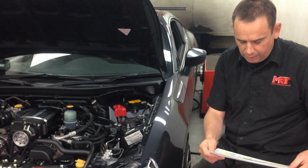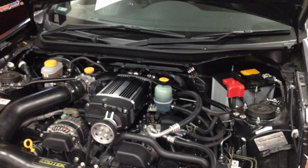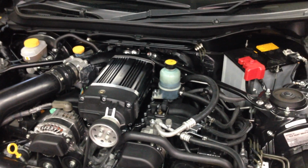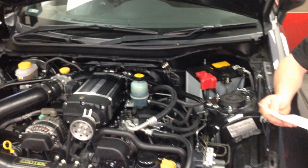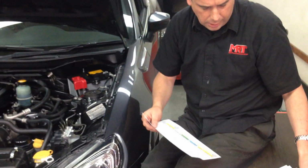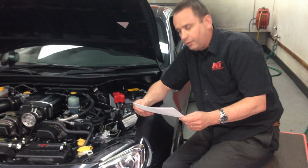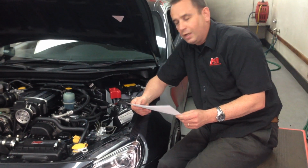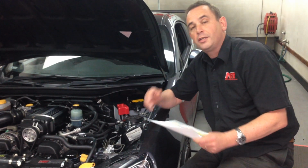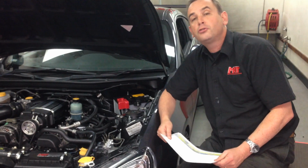Let's talk about a factory standard Toyota 86 or the Subaru BRZ with the standard power run on our Dynapack dyno: peak RPM at around 6,700 RPM, running at around 125 kilowatts at the wheel hubs. With the smaller supercharger in its base model, that's the 210 supercharger, it takes it up by about another 30 to 35 kilowatts measured at the hub. So it runs around 160 to 170 kilowatts at 6,750. But the interesting thing you'll want to know is the net difference with the larger 335 supercharger, which takes it up to 212.